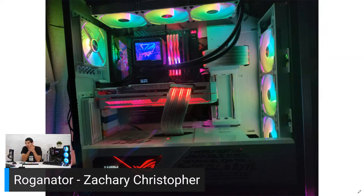megahertz. Well, not megahertz, but it would be MT, right? 16x4. So actually, I don't think he's running that memory configuration. Normally in this situation, I would tell you to drop to two DIMMs because you can't run four DIMMs at 6400 MT. The highest that you could generally run would be somewhere between about 4000 to 4400 MT. Maybe if you had a really good IMC, you could get up to 4800 MT. But to be able to definitely reach 6400, which is already higher than the standard, most IMCs for 12th gen series CPUs can get up to about 6000 MT.